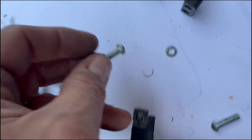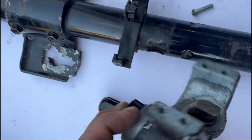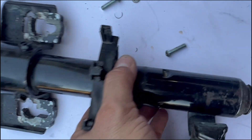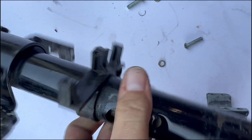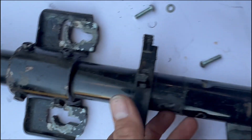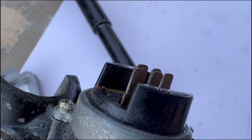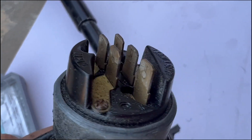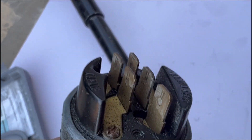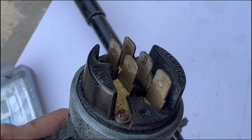There are two small split washers and you'll see there's a hole in the shaft — that's the steering wheel lock. Make sure to line the barrel back up with that hole on the new shaft as well. Now would also be a great opportunity to clean all your terminals and connections, since you don't want to have to go back at this again. Many of these haven't been pulled apart in perhaps decades.